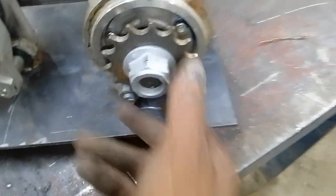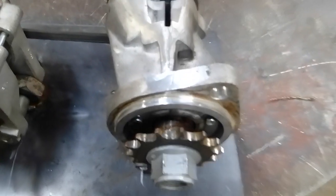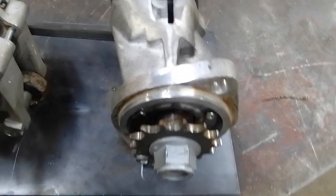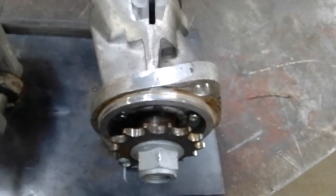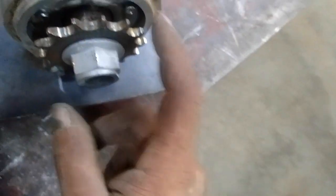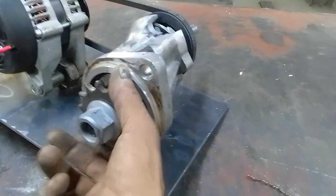On the inside I took a small piece of cover from my alternator just to make sure it's got dual bearings so the shaft cannot move around. On the side where the Bendix used to be, I basically took the Bendix shaft out and copied the pattern on the inside so it can fit perfectly in between the bearings.